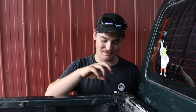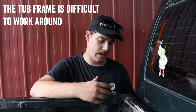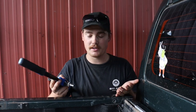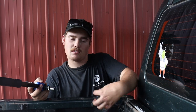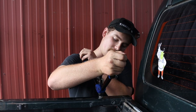The next step was to actually mount the overarching bits of the tub rack. It's two bolts on the side and one bolt going in horizontally. But the way the D-Max tub is at the front, there's a solid piece, and where we drilled the holes in, we realised we can't actually get a nut in from the other side to fasten it down. So we're putting some nutserts in — that way we've got a thread to work with, it's still secure, and we don't have to try and wiggle around the solid bit to tighten it up.